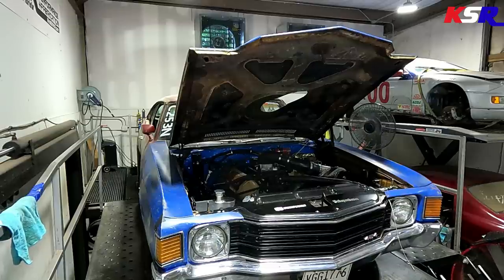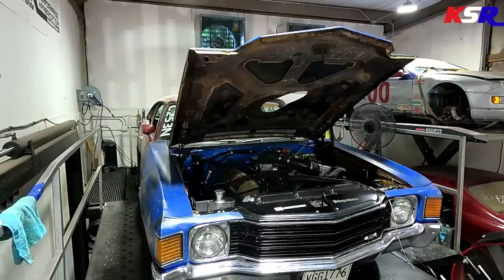Our standard air pressure that we live and breathe in is somewhere around 14 and a half PSI. So when we add 14 or 14 and a half PSI to an engine, it should effectively double what it makes on motor. So even conservatively at 9 pounds of boost, this thing should pick up 180 to 200 horsepower over the 513 that it's already made. So we made another run or two, and it made like 640, but still not the numbers we were really looking for.